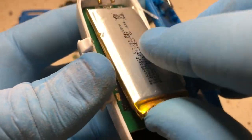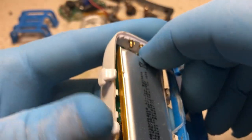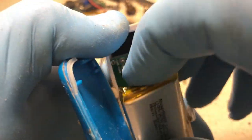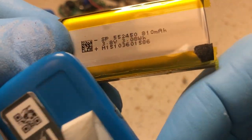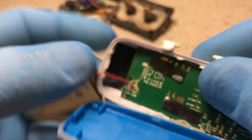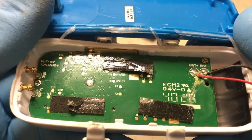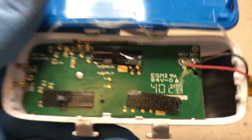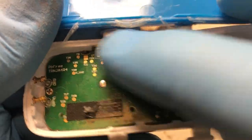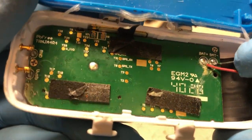Nice big battery — looks like it's stuck onto the board. There's the charging port at the end. Let's see if we can flip this out. There's our battery: 3.8 volt, 810 milliamp hour. Nice and in good shape — this one's obviously not water damaged whatsoever. There are a few screws. We're going to see if we can look on the other side. I don't believe there's much going on this side — this is just tape to hold down the battery — but all the fun stuff is on the opposite side of this board.